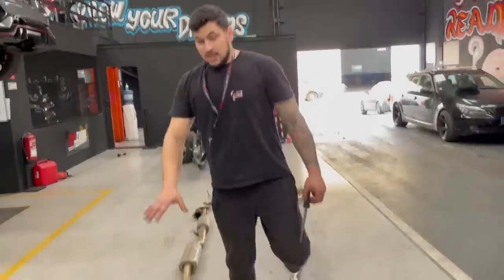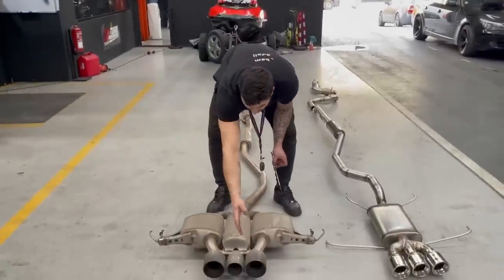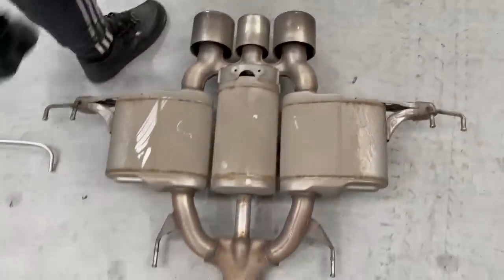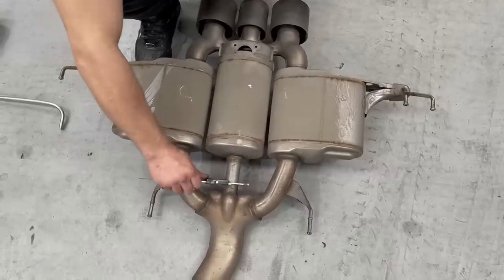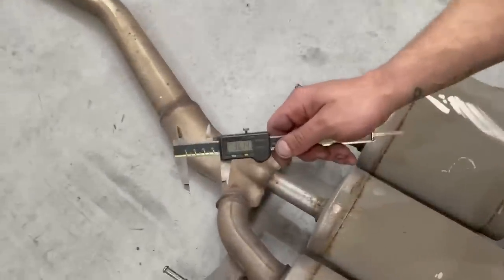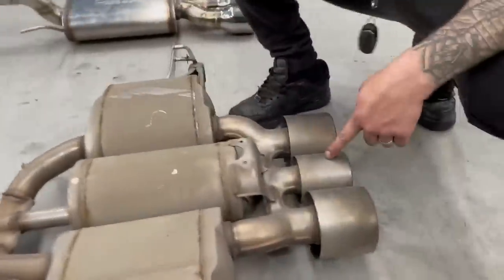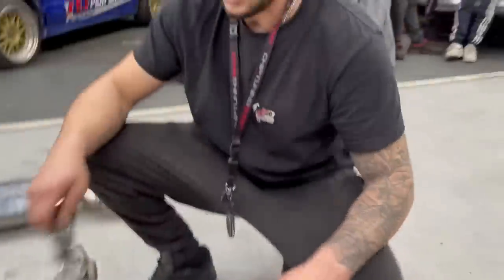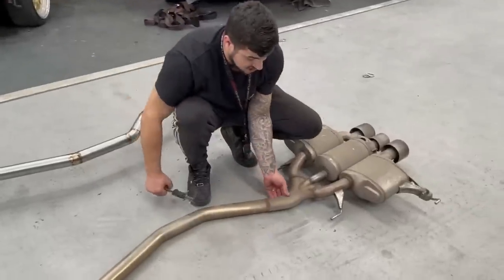Moving on to the final section: the FK8 has three mufflers. This central middle one — you want to see this, it's impressive. This small exit tube here is 36 millimeters. It's not actually doing anything, because the muffler in front of it doesn't feed into this tip — it's just a reservoir of sorts. We come in with a 60mm line that gets flattened as it enters, then splits into three tubes.